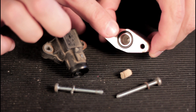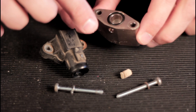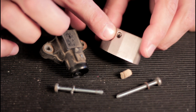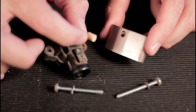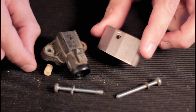So the missing link is just this billet valve right here. Inside here is a check valve — you can kind of see it. It's a little plastic valve, and it'll move up and down and simply vent any excess pressure right through this vent hole here. There's also a little air filter that comes with it that keeps everything clean — I have it removed so you can see it.